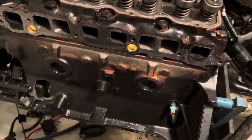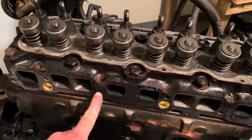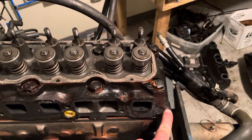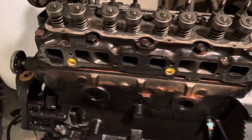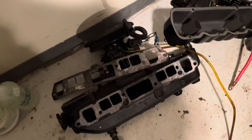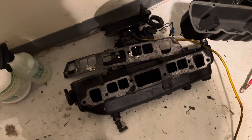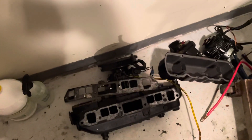The last thing done so far is we took off the exhaust manifold. There were two studs here, a bolt here, a bolt here, no bolt there, and another stud back here. Once those were all loosened up the manifold came off. You have to be careful — this fitting down here on the bottom is plastic, so you can't just set it straight down or it might break.